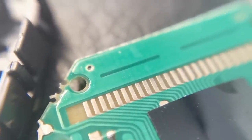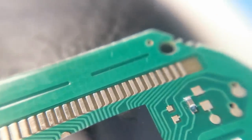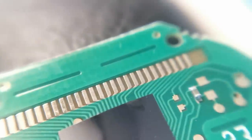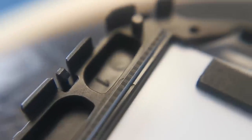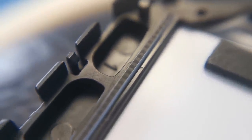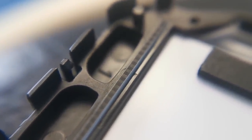So an obvious question to ask is how this printed circuit board makes a connection through to the LCD display, and the answer is this row of output pins from the integrated circuit that you can see here. Now they flip over and connect to this sort of connection rail embedded there in the watch, and that makes the connection through to the LCD. So actually this is a really elegant design. It's just pushed up against that, which means there's no ribbon cable inside here, the management of which would be really irksome. Anyway, there we are, nice design, really good stuff by Casio.